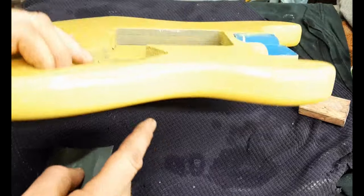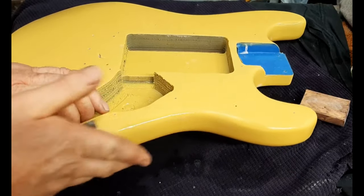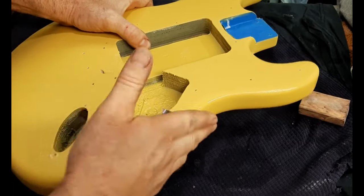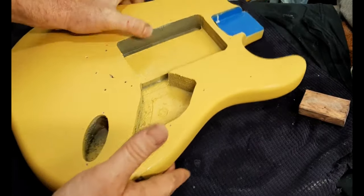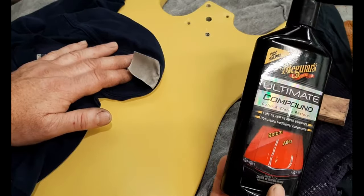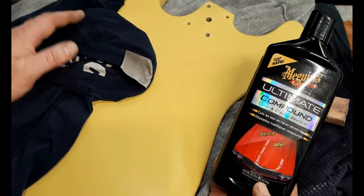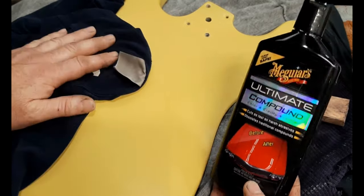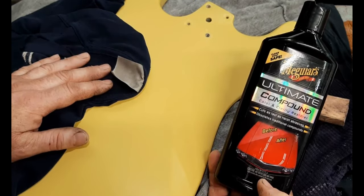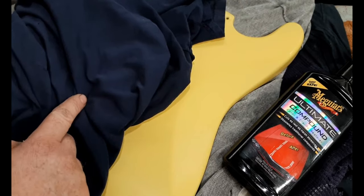As far as the sides and corners are concerned, I'll just wrap some 2500 around it and go around it a couple of times because I don't want to wear it down for this paint job - just smooth it out a little bit. For the polishing, I'll use this automotive polisher, also available at auto parts stores. This is the white one and it's a polish, not compound. You can use the compound first if you wanted to, but I'll use this and then on top of this use some turtle wax just to get a little bit of gloss.